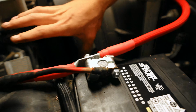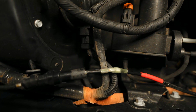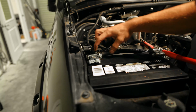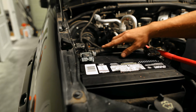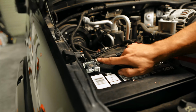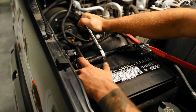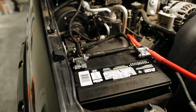With your charge pipe, it'll cover all this. It'll look really nice. This relay, I'm just gonna go and plug it back in over here. So for the passenger side negative, we got that little 4-gauge wire from the fender ground. It's gonna route like this on the inside, and then this bigger guy is gonna come around, and you're just gonna tighten all that down. 13s and 14s, that's what these terminals are. Just like that. All nice and clean.